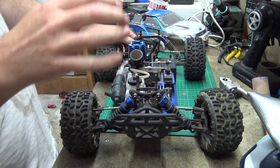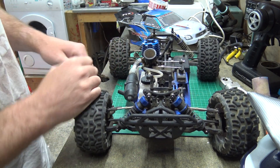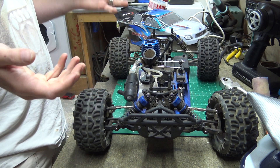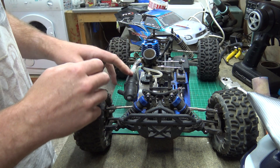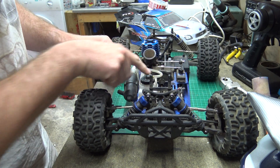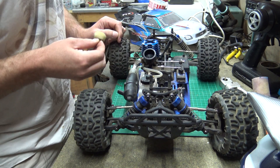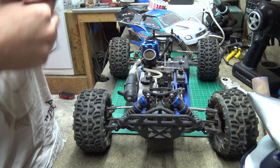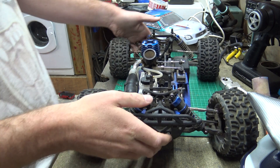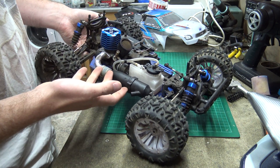Make sure your air filter is clean. If you're turning your needles to tune your engine and it's not making much difference, check that you've got no leaks in your fuel pumping system, no leaks on your carburettor, no leaks around anywhere — that will cause a problem. Other than that, nitro engines are incredibly simple. Make sure your exhaust is done up properly too, because these are two-stroke engines and they do rely on the exhaust to run properly.